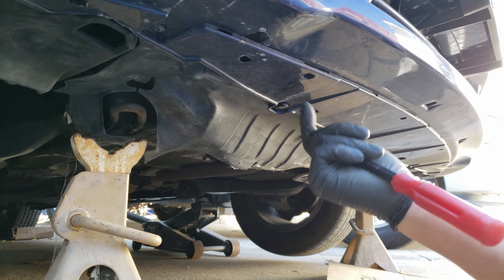Let's now disconnect and remove our battery. Using a 10mm socket, we'll start by disconnecting the negative terminal. Should be able to loosen it a couple turns and rotate the terminal off. Now for the positive terminal, but this one has some wire terminal on it, so I'll just use a wrench.